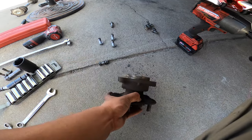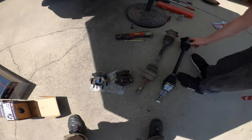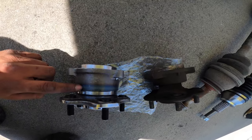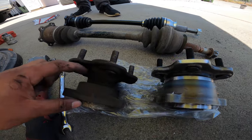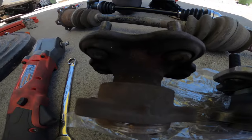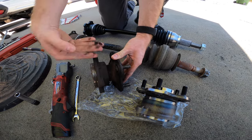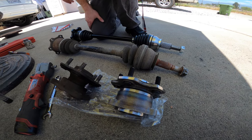You guys saw me just pull this wheel bearing out, man. So this is everything right next to each other. We're just over here going through it. It's a great point about this taking up a lot of force, because look at how big this is compared to the other one. See how this is a lot fatter? Deeper. A lot deeper, as Zane likes to put it. Because this is just the actual hub shaft, no? Yeah, wow. So it'll cope with perpendicular forces a lot better. You can twist this guy like this a lot easier than this guy. So since this guy's wider, it'll cope with those perpendicular forces a lot better.